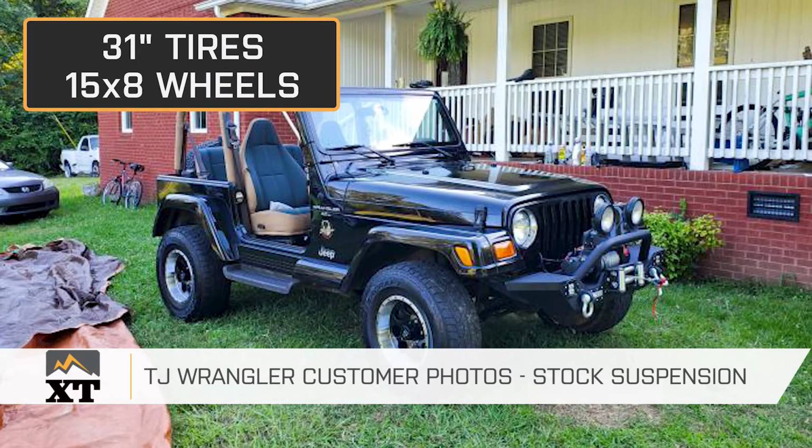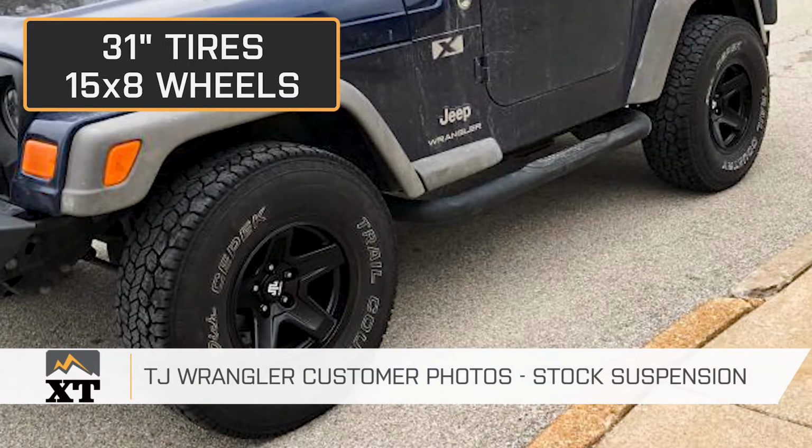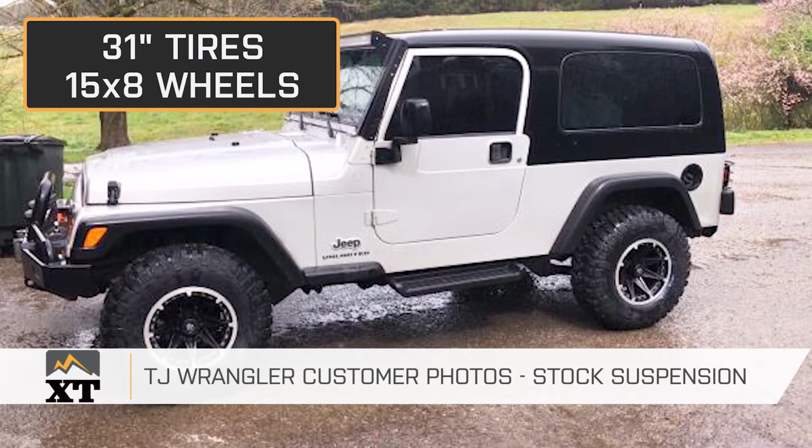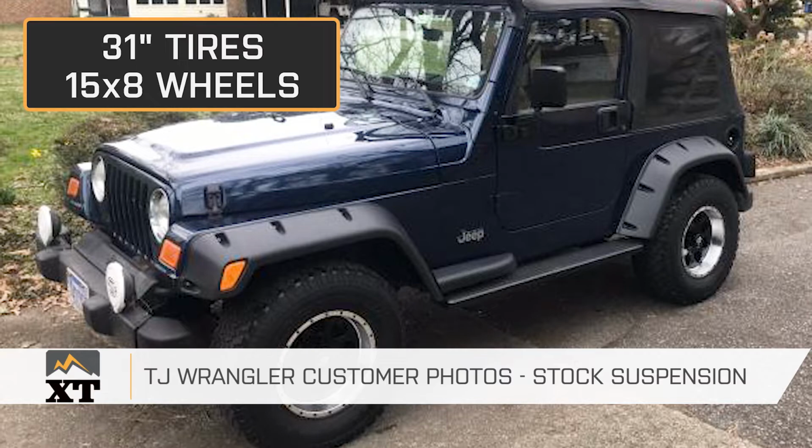This wheel and tire combo will fit all non-lifted stock Sport, Sahara, Rubicon and Unlimited TJs without needing any other modifications. This setup is ideal for those of you that aren't lifting your TJ, but you're still looking for that more aggressive stance that's going to come with bigger tires. Customers running this setup are staying mainly on road. Keep in mind, this is the biggest tire you can run on a stock non-lifted TJ.